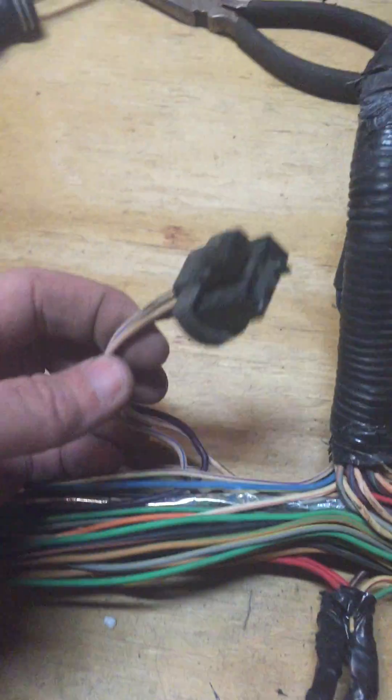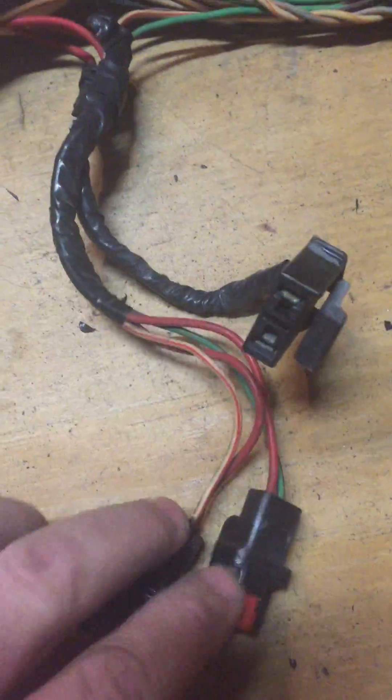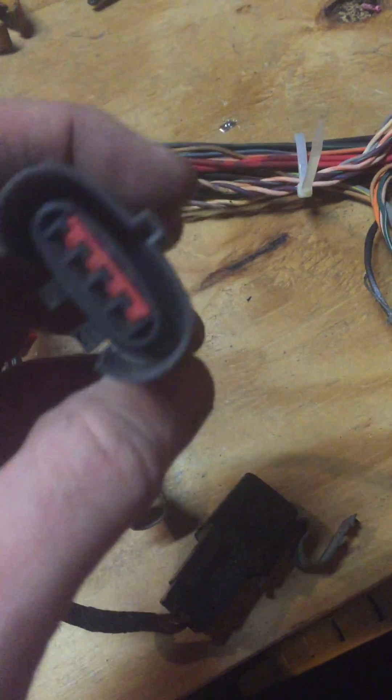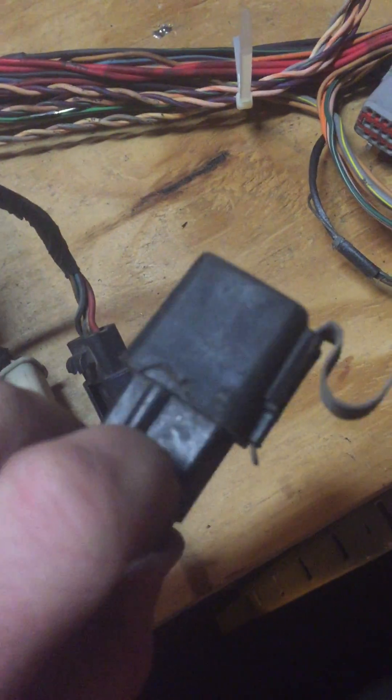All the salt and pepper shakers — this canister and some air conditioning connectors are going to get removed. I have these written down. I actually remove the wires from the connector. I have a bunch of them from the last conversion that I did. Back here, these all come out too. This one stays — this is the mass air; this goes right on the mass air sensor. And then this one is your fuel pump relay — I'm going to clean that up.